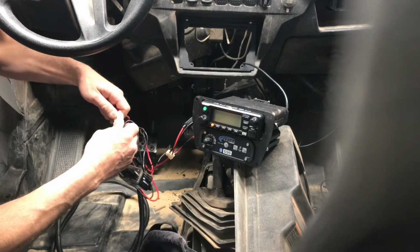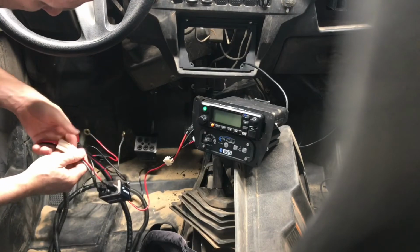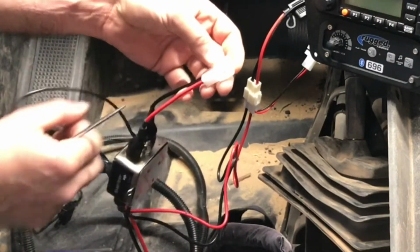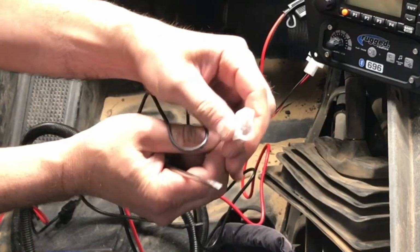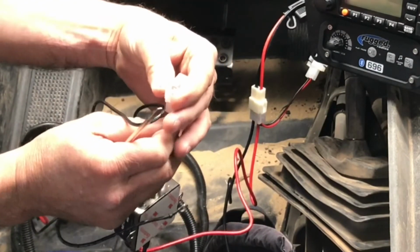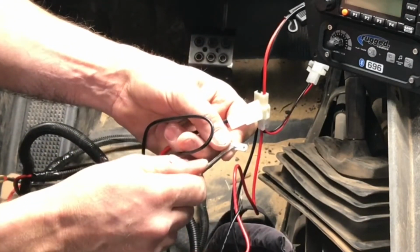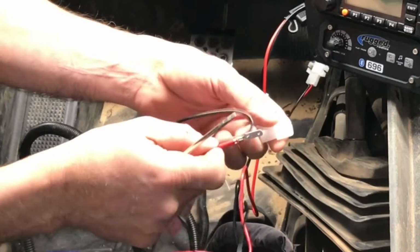This is one quality concern I had about this kit. When I went to plug the main power harness back into the active filter, it pushed one of the spade connectors out and was making a very poor connection. So I did realize it, and then if you'll notice here, I'm able to pull this wire out. You're supposed to have to push in a little tab on the other side of the connector in order to get these out. So right here, you'll see me spreading that tab back out so I can plug it back in and lock it into place.